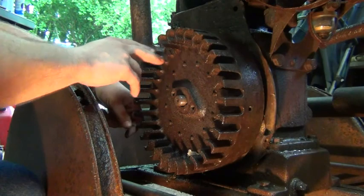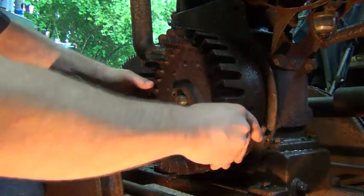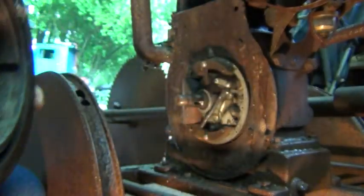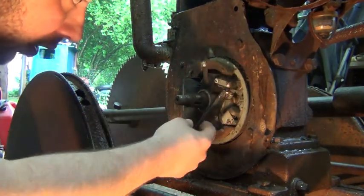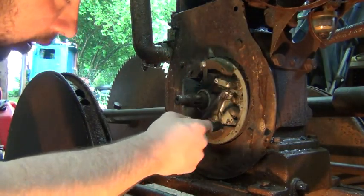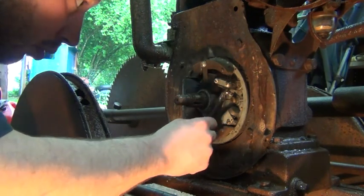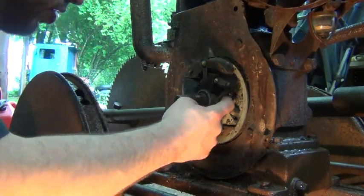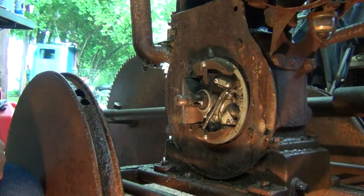Ready to pull the flywheel off. As you can see, there is one missing fin, but it's in pretty good shape overall. It was stuck on there pretty good - they usually don't require that much effort. There's one heavy sucker. Someone's been in here playing around. There's all kind of electrical tape going on on the low-tension wire. The condenser wire's not even attached. Points are just filled with stuff. Got a little cleaning to do, but we'll be in good shape.